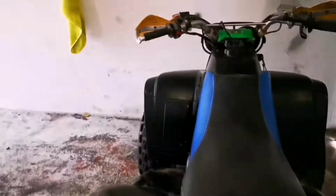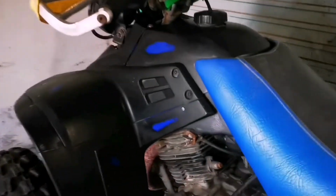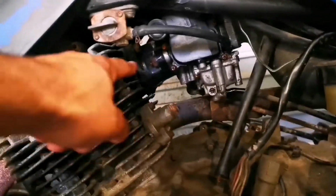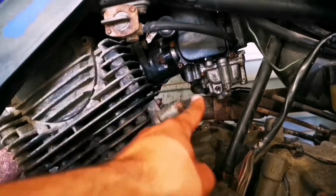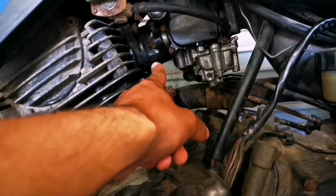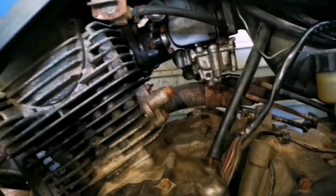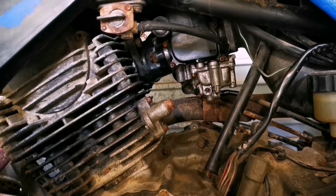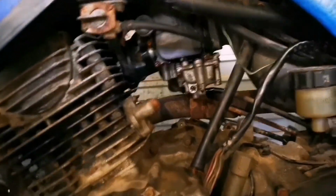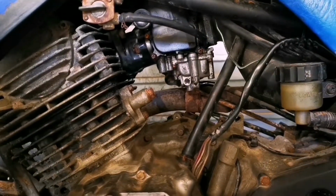I would not have minded starting the quad for you guys now, but if you can see in here, this rubber boot that holds the carburetor has a slight tear in it here at the bottom, so it makes it difficult for the Warrior to idle. So hopefully in the next video we'll have that sorted, then we'll give you guys a start.